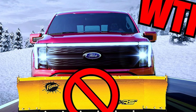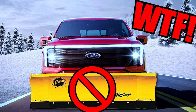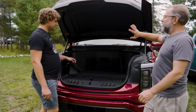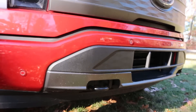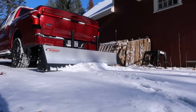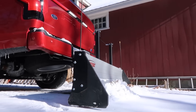About a year ago we put out a video showing how we tried to get a snow plow mounted to the front of our Ford F-150 Lightning. We called major plow manufacturers and they told us it couldn't be done. There's no 12-volt battery on the Ford Lightning, so you can't run a snow plow. We visited plow installers and they said that because of the frunk on the Ford Lightning, the air intake and the coils had to be moved lower by Ford in the front, which gets in the way of the frame rails for any of the off-the-shelf snow plow attachment kits. So we did the next best thing and attached this HD Snow Sport Aluminum Blade snow plow to the rear hitch and plowed snow backwards.